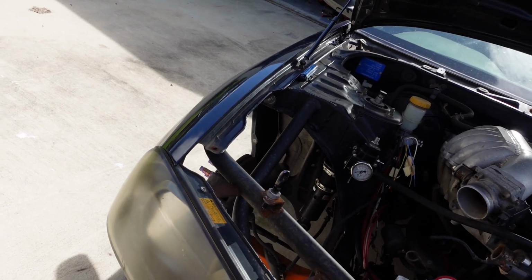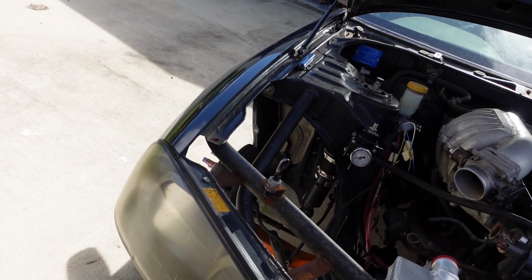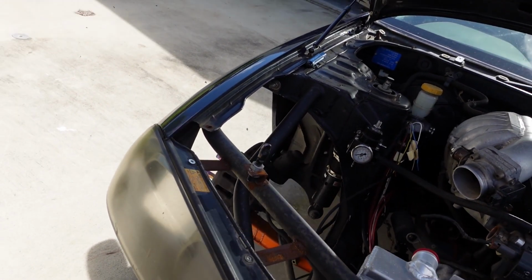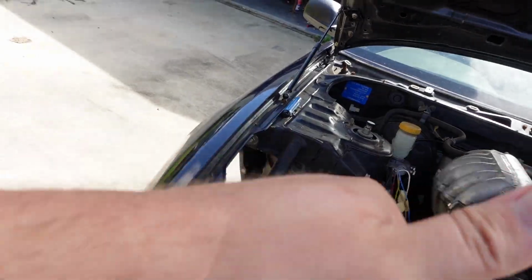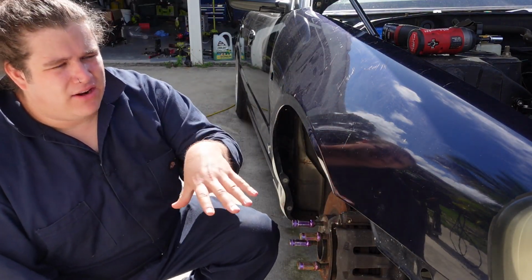I'm going to put the camera down for a second and tack this plate in. I'll do the same for the other side. When you see me in 2 seconds, they will be tacked on, and we'll be ready to weld them out. Okay, so I've tacked the plate to the tube front, so I just need to take this guard off so I can weld it out fully.